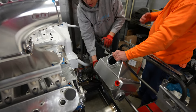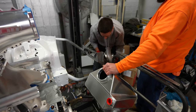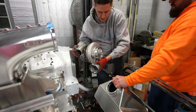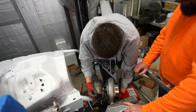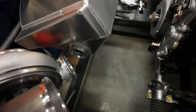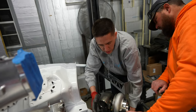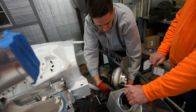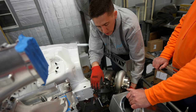The radiator is coming in probably about there, so we've got to get down to the inlets on the intercooler from the outlet on this unit with some aluminum piping. If we're here, that's pretty close — a super little piece right in between there and we might be able to make that work. We've got to get one thing hung and work on the other, but this is why I didn't want to mount this yet. If sliding that back just a little helps with lining up to the exit on here that's okay, but that other side is going to be a different story — we'll have to come out of the turbo and down to it.